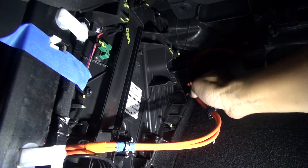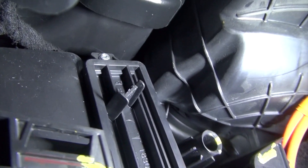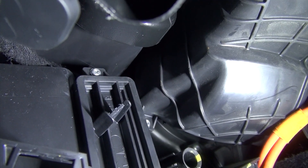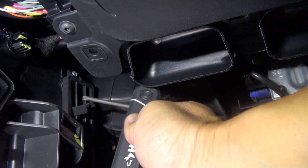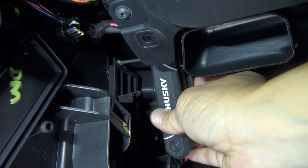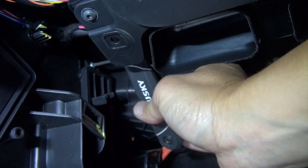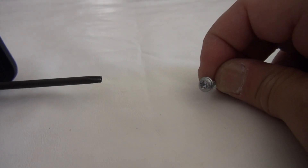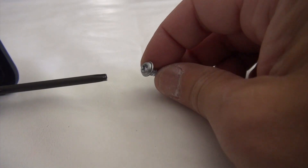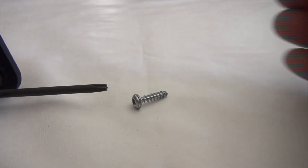Keep it out of the way. On top of the panel you'll see a screw that you need to remove with a special T20 tool. See the screw right there — it's perfect to use this tool because it fits just right and gives you the angle that you need. The screw is kind of a star shape and it fits right in there. It took me a while to get it out because of the small space you have to work with, but eventually I got it out.